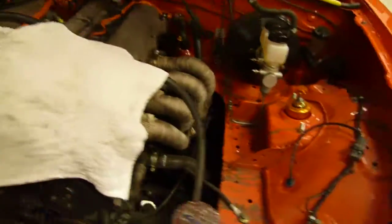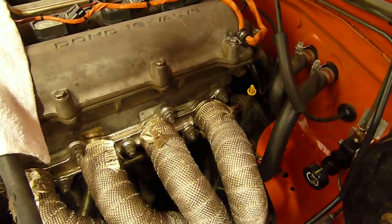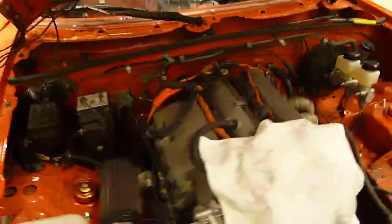Out in the engine compartment, we have another nozzle at the cold side of the engine, basically aimed at the fuel rail. And over here on the hot side of the engine we have one too — that covers massive engine failure scenarios: a rod comes out the side, oil gets on the header, boom — you've got an oil fire. So that's where we like to position our nozzles.